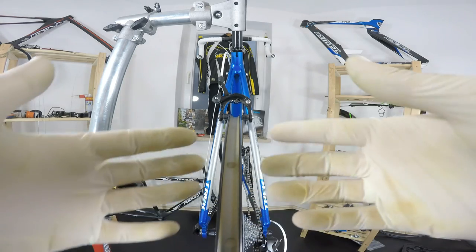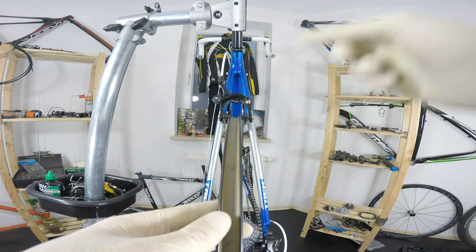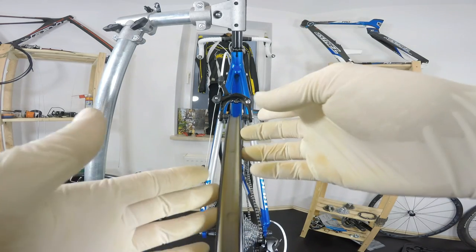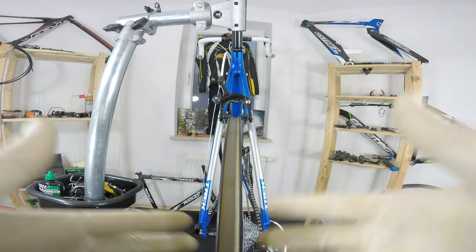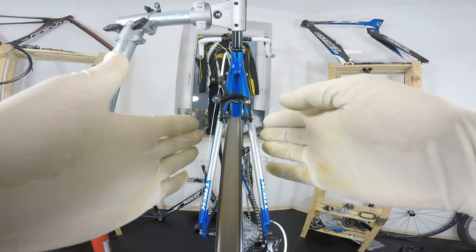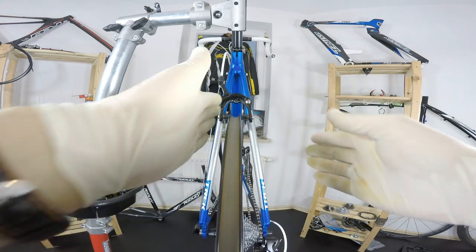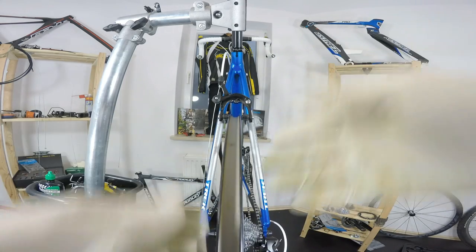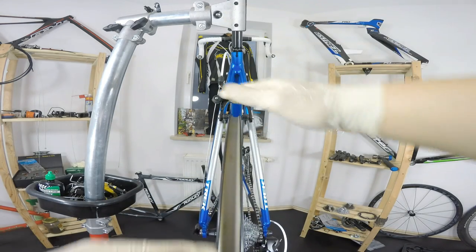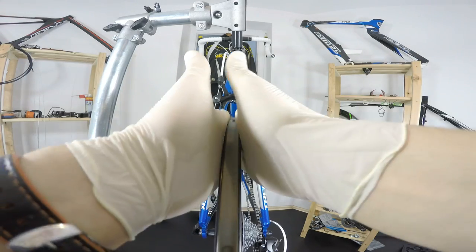Sometimes it won't be possible to true the wheel completely, like 100%, or to less than 0.5 millimeters. We should remember that as well. And then the wheel can be out of true laterally, going to the left and to the right side, and radially, it's called radially, right? Going up and down. And the third kind of being out of true is the dish of the wheel.